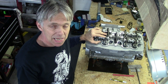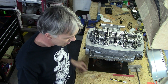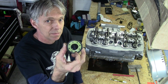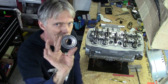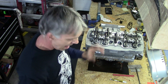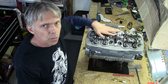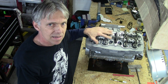The engine's about 90% complete. Now it's down to the external stuff — the oil filter and some side covers, maybe a few extra seals. I forgot to put in the final drive seal. Somebody mentioned this in an email and said on their later F-series bike you have to put that in before you put the case halves together. I ran out to the shop, looked in the manual, and realized I'm okay — I can still put this in because it doesn't have a lip on it like they do later on the F-series bike. So that'll have to go in later along with a few O-ring seals and things like that.